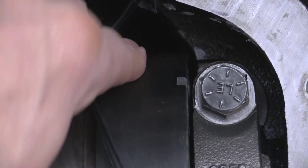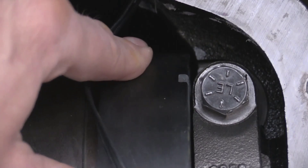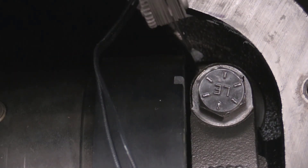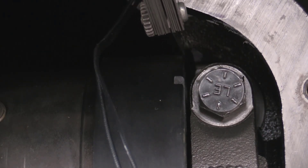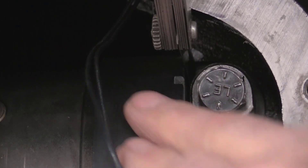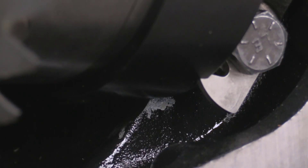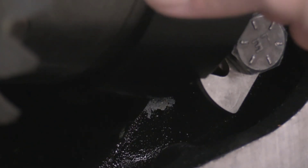This is the final check for clearance between the electromagnet and the differential housing. It should not touch the housing at all — Auburn calls for a minimum clearance of at least twenty thousandths of an inch. It should free-float and not be bound up by the small retaining bracket on the lower bolt.